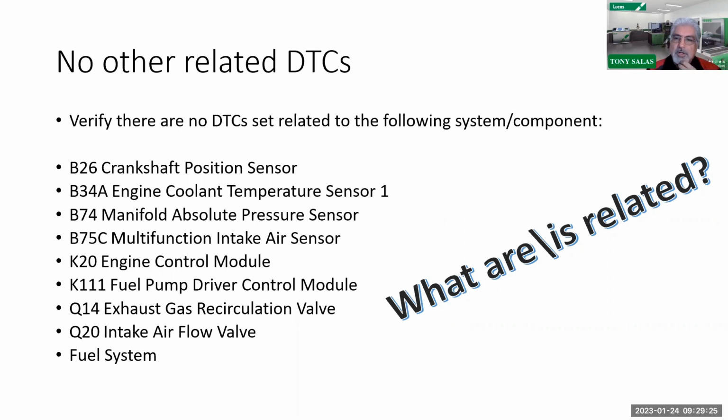And the answer is no. We only see a few cylinders do it. I've never seen one where all the cylinders were affected, and if you've got one, let me know, but I've never had it so far. The ones I've seen, and the ones guys have talked to me about, I've never seen one where all 8 cylinders set codes for timing and quantity.